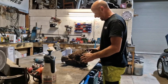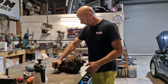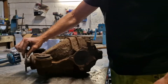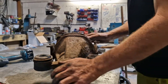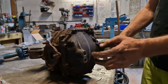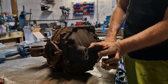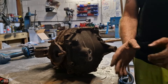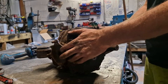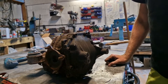That was a right pain to get off. These bolts weren't too bad, they were okay. Those were tight as hell, managed to get them. But these ones are hex head, 12mm, and we couldn't find the tool for it for ages. I found the tool but it's too long because the wheel arch is here, so had to cut it down to get it in there. But we got it in the end. Next thing is get the back off, drain the oil, and we'll have a look.